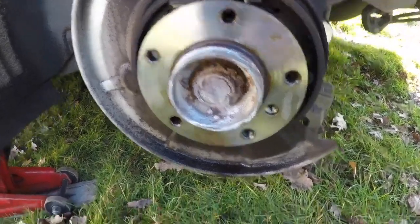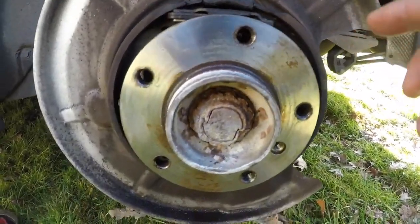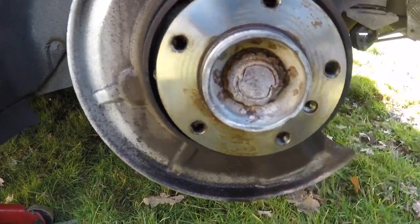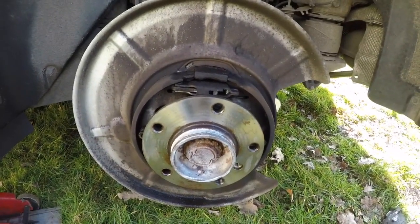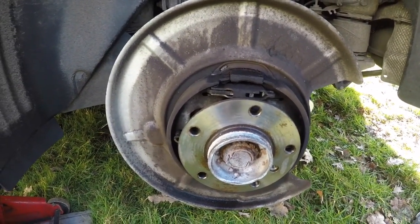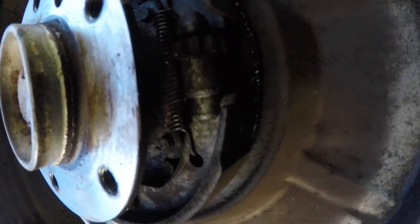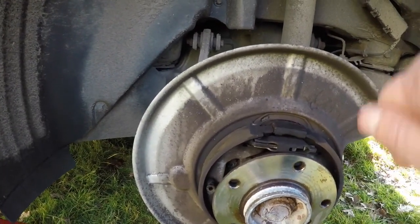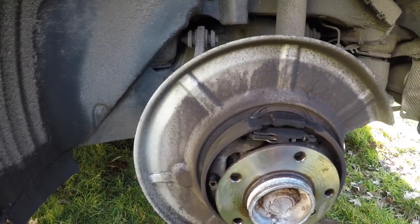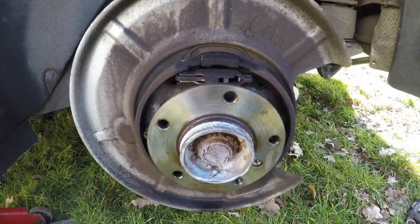The other rear brake disc is now off. I want to quickly show you the adjuster for the handbrake shoes — it's right down here. To access it, you turn the hub to line up any of the holes with the adjuster. You don't actually have to take the brake disc off to reach the adjuster — just shine a torch and it sits right down there. It's the same on both sides. Turn up to loosen and down to tighten — or actually it's up to loosen.